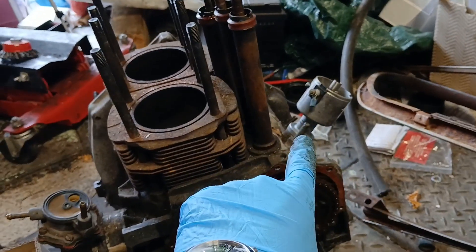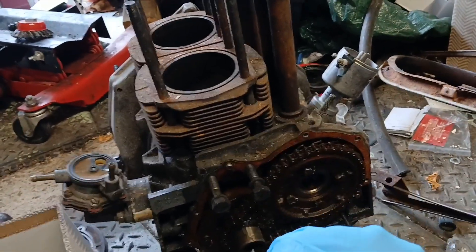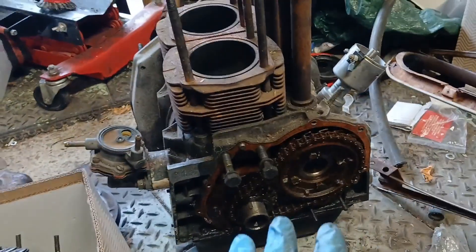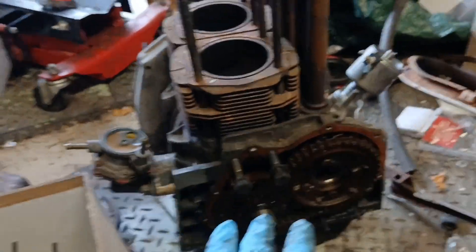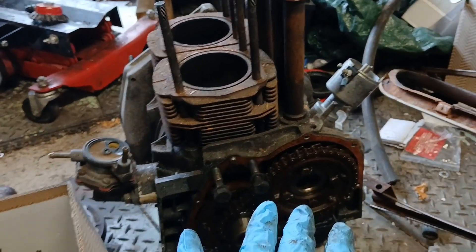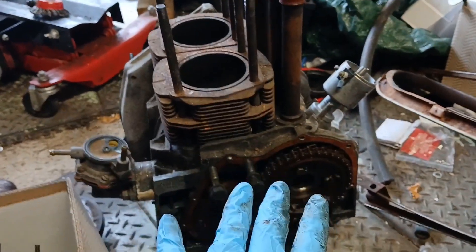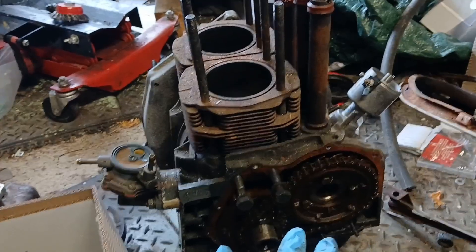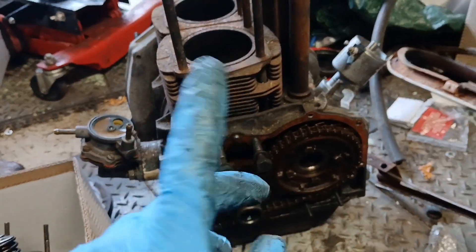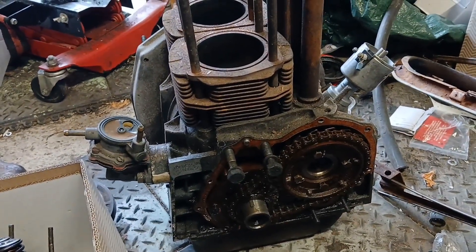Then we're going to fit a nice British one and a quarter inch SU carburettor on top, a new fuel pump, and run a wasted-spark 126 ignition system. All of these things are stuff that anybody can do in their shed or garage to make their engine run as well as it can without spending huge amounts of money — and it's going to be absolutely perfect for pooting around town and keeping up with traffic, far more so than the old 499cc was. Give us a like, give us a subscribe, hit the bell and you'll be notified as we get further along with this.